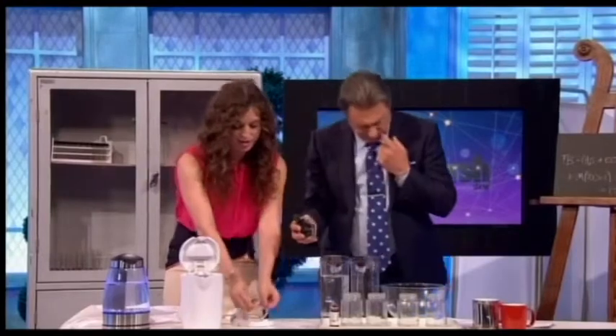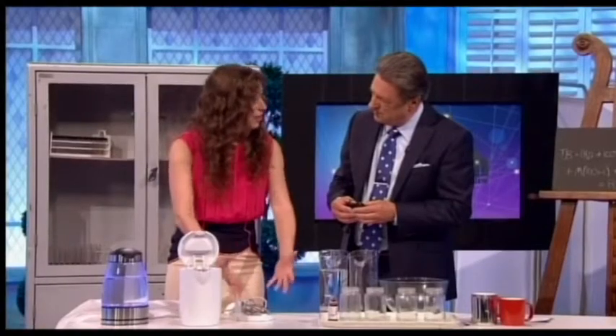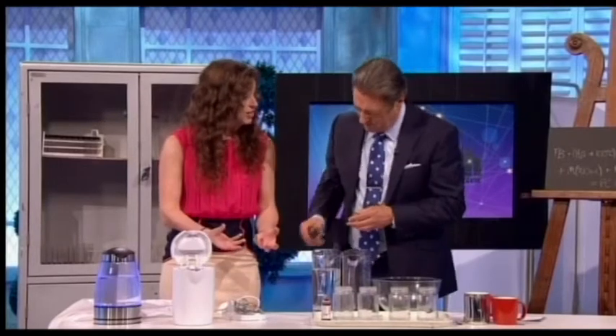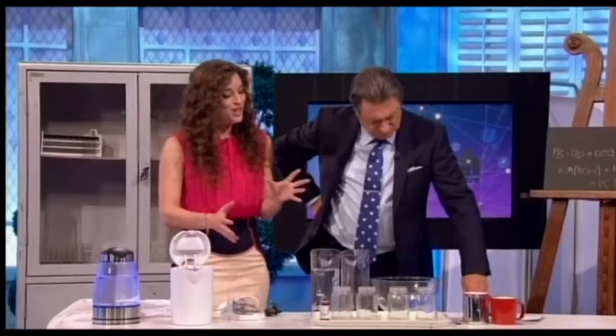This element is made of metal with a very high resistance, which means when electricity flows through it, it gets really really hot — because it pushes back on the electrons, creating friction. That friction generates heat, and that heat is conducted straight into the cold water around the element. Here's the cool bit: because the cold water is at the bottom, when water gets warm it expands, making it less dense, and it rises — setting up convection currents that flow through the kettle. That's why the element has to be at the bottom.